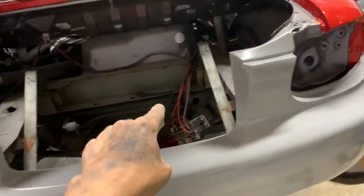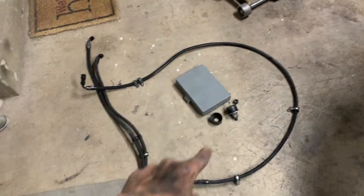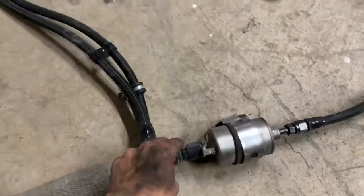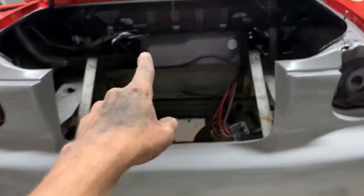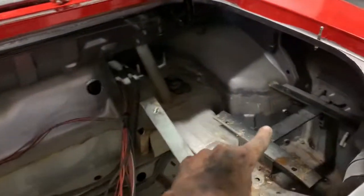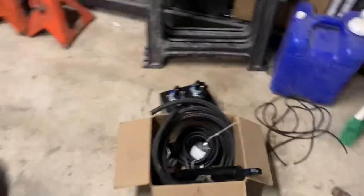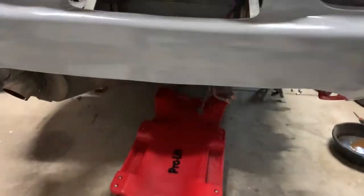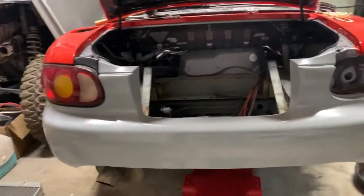In the process of doing the wrap I figured I'd take it upon myself to begin the fuel system. With that being said I went ahead and removed the radiator, removed the battery, the battery tray, and we're going to relocate that stuff to the driver's side. Then I went ahead and removed all the lines and the old Corvette regulator so now I could take some of these lines and run them from the tank to the surge tank, which will be on the passenger side. We have all the new stuff ready to go inside the car all the way to the front. We have a nice clear platform underneath the car to start with.